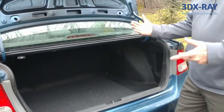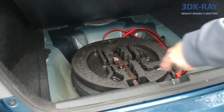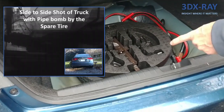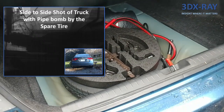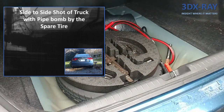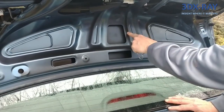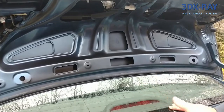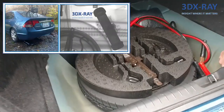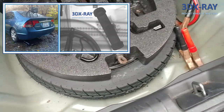Let's say a device is placed down inside the spare tire well. Anywhere inside that well, if you're shooting from one side to the other, you can start counting the multiple layers of metal you're trying to cut through versus shooting top-down. At the top part of the car it's one millimeter and one millimeter — about two millimeters total. At this part it's probably two millimeters, and at the bottom going down you have a very thin sheet of metal, about one millimeter.